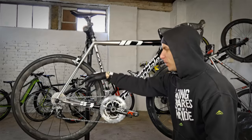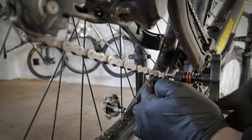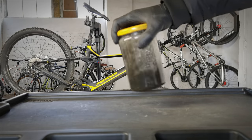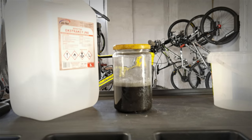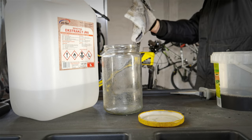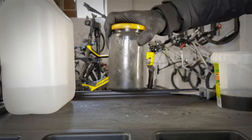Moving to the second experiment, which was the most surprising to me probably since the beginning of my channel. It was all about lubing the chain with canola oil — super cheap — and riding 60 miles in the mud. To make sure I only had canola oil on the chain and no other lubricants, I did a triple deep clean — I also call it a chain shake — three times with petrol. In Polish it's called extraction gasoline; it's not the same gasoline you put in your car.